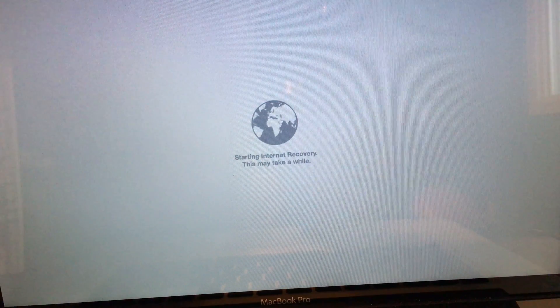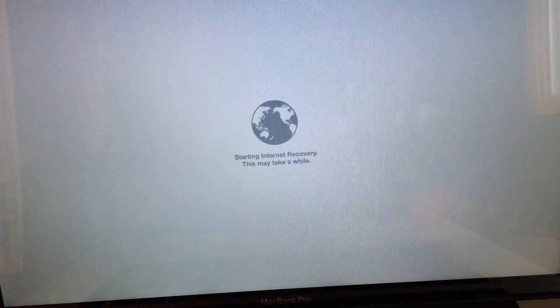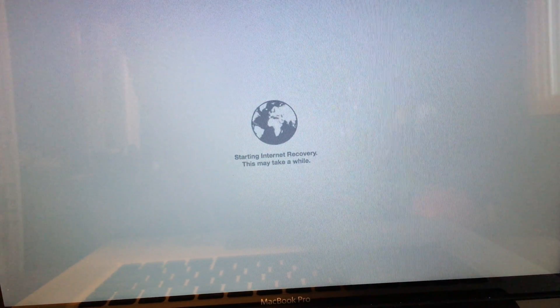When you turn on your Mac for the first time, make sure to press Command+R. I'm going to press that right now to install our new SSD. Like I told you, you have your Time Machine backup, which is great, so we can go ahead and format our SSD. Hold Command+R until you see a loading bar. It really depends on your Mac how fast it is, so just press Command+R and you should be fine. Now I can see it and it's doing internet recovery.